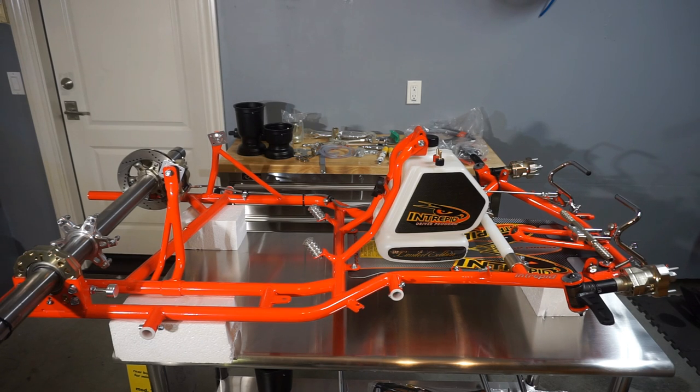We didn't like how they handled. A lot of them were stripped down versions that didn't come with all the accessories, but most importantly they just didn't handle really well. What a lot of us didn't know is that all those four-stroke chassis were actually developed for the Canadian market where they have a 50-inch wide max width, so they had to soften the chassis up with S-bends and 28-29mm frames so the karts didn't get up on two wheels. But when we brought them over to our area where we run wider than 50 inches and our tracks are tighter, they just didn't work well.